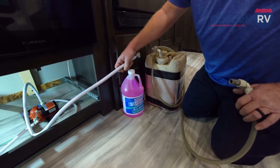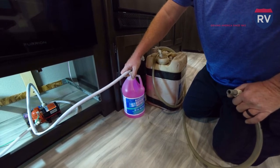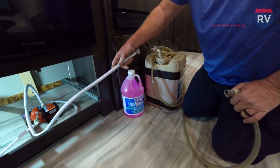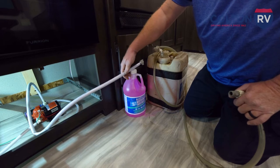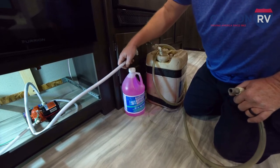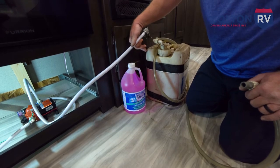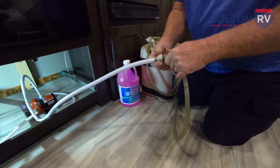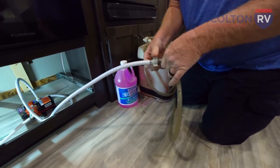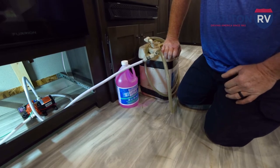You're probably going to need two to three gallons of antifreeze to winterize a unit of this size. You can either stick the hose directly into the bottle, get a five-gallon pail and put your three gallons in it and stick the hose in the pail, or — like we do — use a five-gallon pail with a hose hooked up to it and just flow antifreeze through.